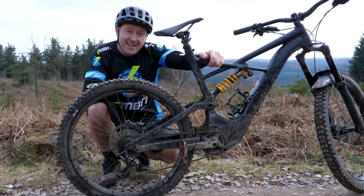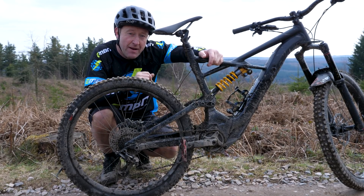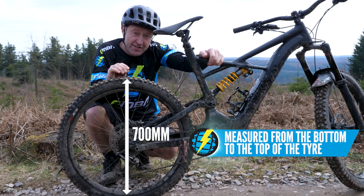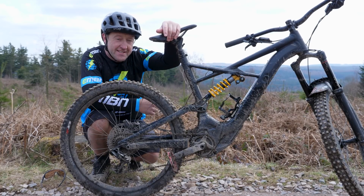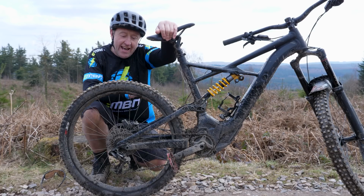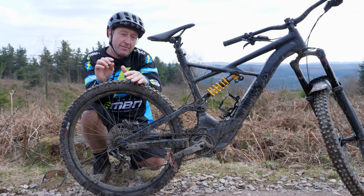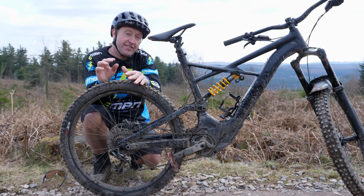An interesting aspect of this test is how both tires affect the geometry of this 180mm Specialized Kenevo. The Hillbilly measures at 700mm outside diameter, whereas the Butcher Grid comes in at about 710 millimeters. That 10 millimeters is significant — it knocks the bottom bracket from 350mm down to 340mm, though that's still a good number for a 180mm travel bike. What I'm thinking about is whether that actually affects how the calibration of the bike works, and the effect on battery life.